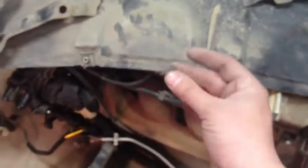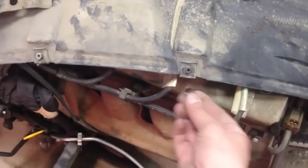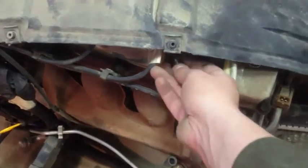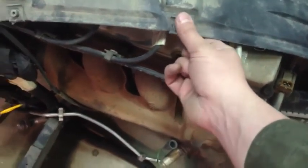The screws, I'll show you what they look like. They are these, there's I think 4 or 5 each side. They're just a little tiny, basic Phillips screws. And what happens is the fender liner goes on the opposite side of your little metal tabs. Then these screw into them. They go up inside, and your metal would be on the opposite side, the back side of this. Then your screw, even further beyond that, sandwiches it in there. And they screw into these. This is where the thread is. It's on the actual fender liner itself.